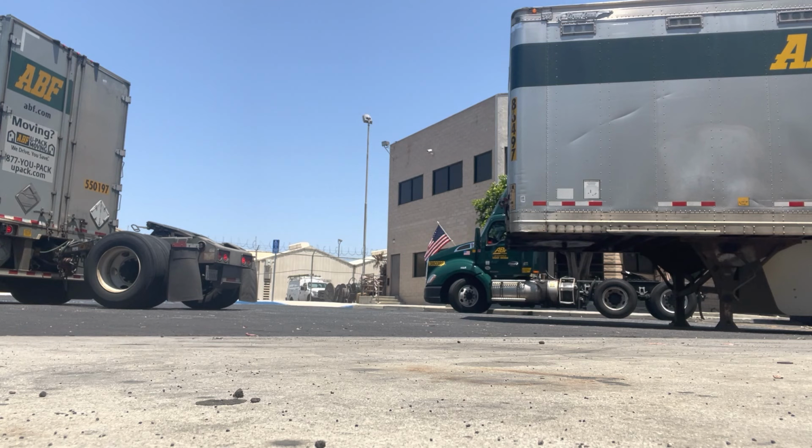Like I said in another video, you'll be fighting yourself if you're trying to couple this gear to your rear trailer. It's not gonna roll the way you want it to roll. So, obviously I tested my lights. You wanna hook up your air lines and then of course go and depress the emergency brakes just to make sure that there's no leaks on the gear. That way you can solve that problem.